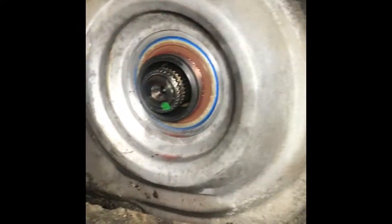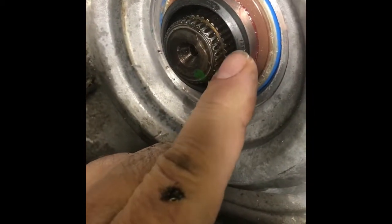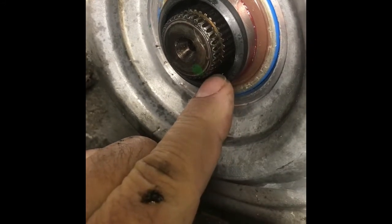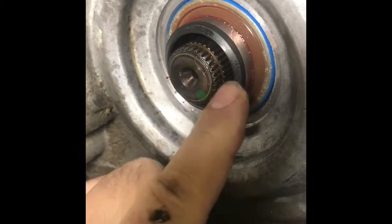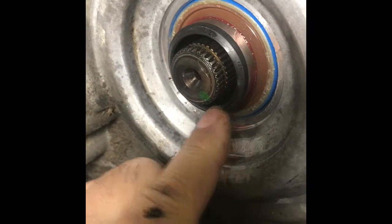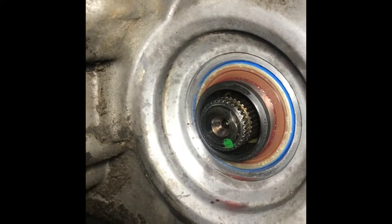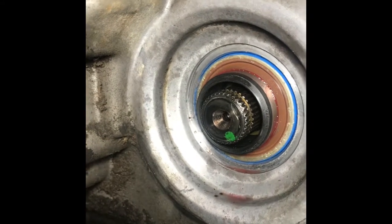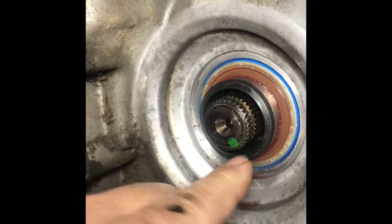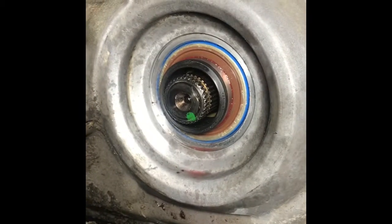I did some pre-measuring before I drove this in, and I've determined that if the very outer lip of this cup is offset back around 5/16 of an inch from the face of the shaft, that's about the depth you want to be. In driving it, I'm not sure it didn't bottom out in there, and it won't go in any further anyway. I came to a dead stop and then measured, and sure enough it's right around 5/16 of an inch. There it is. New seal. I hope it works good.